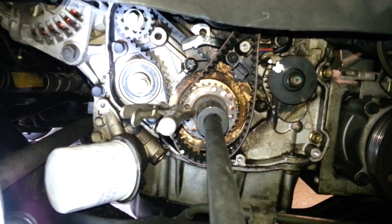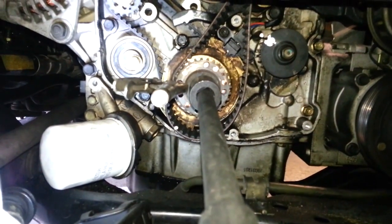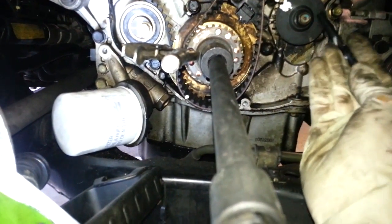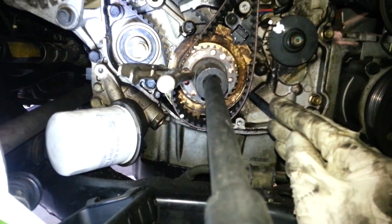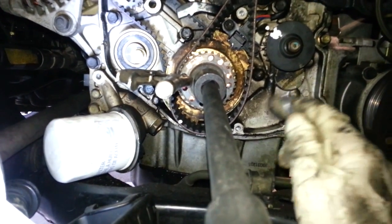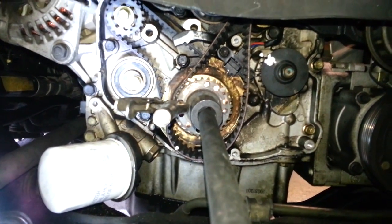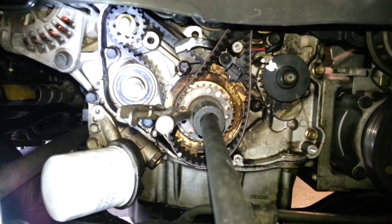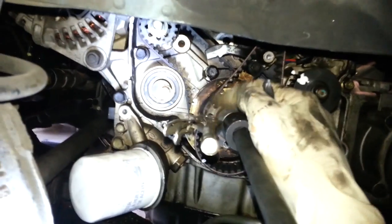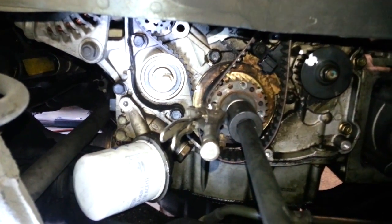All they tell you is to line up the marks and go. If you read carefully, the instructions will tell you to put a screwdriver or drill bit in to loosen and tighten the nut. But it doesn't tell you that it is a gear reduction unit and you can spin it and it will throw off the timing and cause your engine to vibrate like crazy. So just keep that in mind. Thank you for watching — leave me some comments and tell your friends who are mechanics to watch this video.